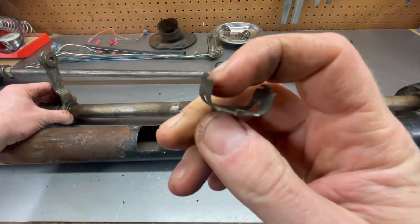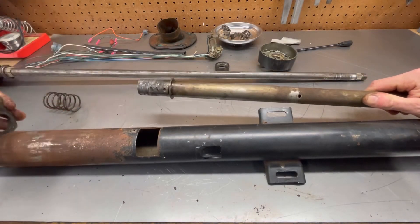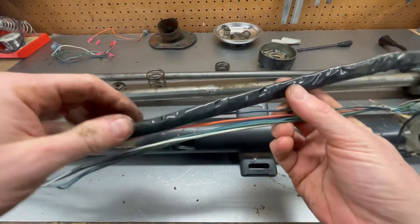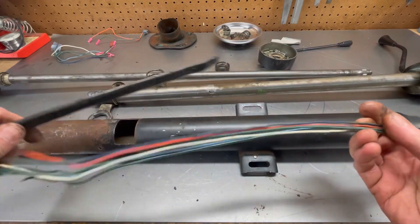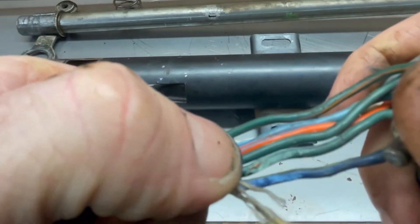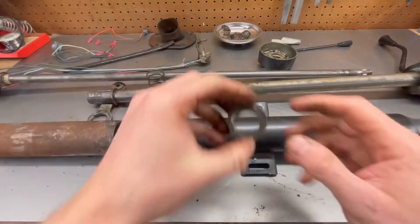You've just got to pull the little indicator here for the neutral safety, which clips on. One little tab did crack on me despite being as careful as possible, but we'll deal with that when we go to reassemble. Once that's out, the shift tube braid will slide up and your selector will slide out of there, leaving you with just the bare shaft. The wiring itself was a little tricky to get out — somebody had been in there before and it was wrapped with tape, so it was quite tight inside the tube. I sprayed some silicone lube up in there and slid it back and forth until it finally came free.